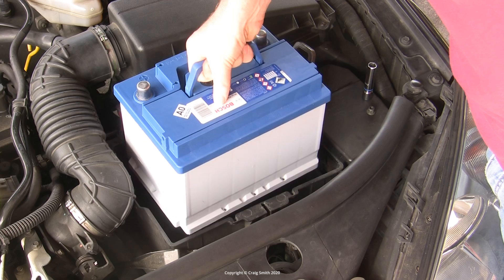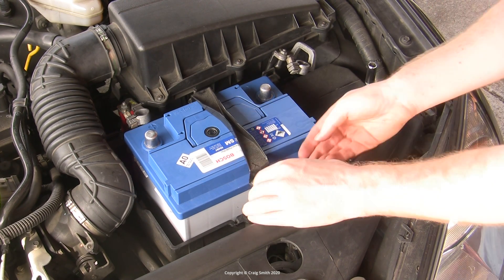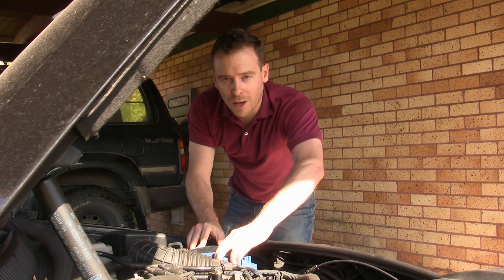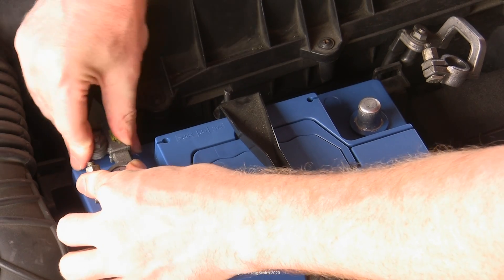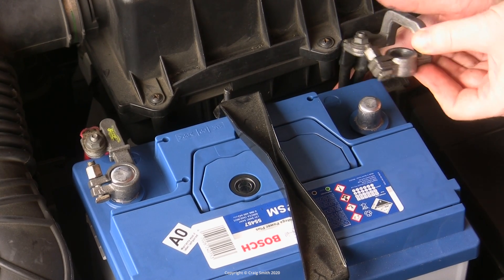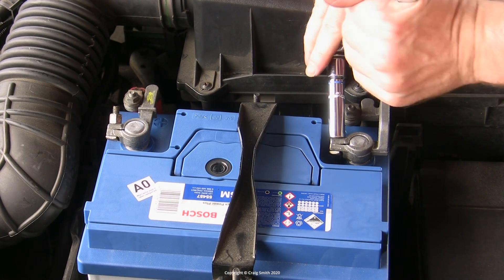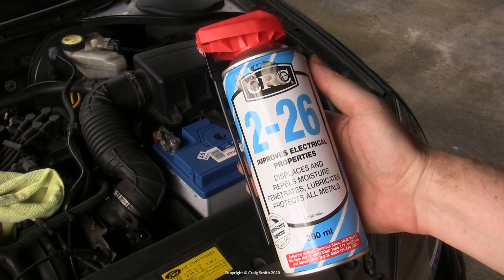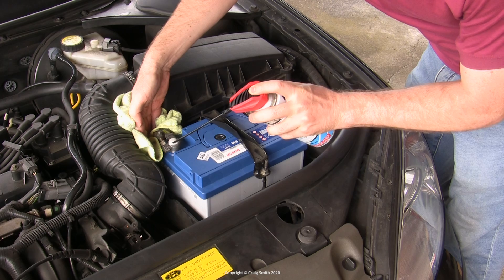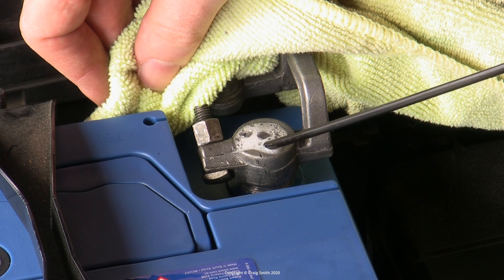Put the new battery into the battery box with the terminals to the right side. Put the retaining strap back on and tighten up the nuts. This needs to be tightened down but not so tight that you crush the battery — just check that you can't easily move it around. Then do the connectors: positive first, negative last. Most of these connectors are a clamp closed by the nut — close it until there's no gap visible, and there's no point over-tightening beyond that. As a last touch, add some protectant to the terminals and connectors: silicone grease, a spray, or even Vaseline. I'm using a dedicated electrical protector spray, which should keep all exposed metal in good condition.